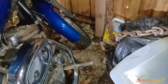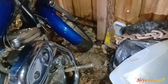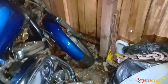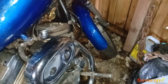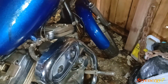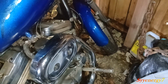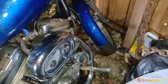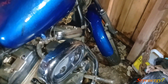You can use all the professional body shop stuff, but a lot of times I'll sand it and use this stuff called Awesome, the cleaner from the dollar store. It really cleans the heck out of it. Then wipe it down with clean rags, and I'll go over it with glass cleaner, and that gets it pretty chemically clean. You'll know it's chemically clean if you don't have fish eyes in it, which come from oil. And as long as it's scuffed up enough to have some bite, you're better off erring on the side of too scuffed up versus not enough, because you want that paint to stick.